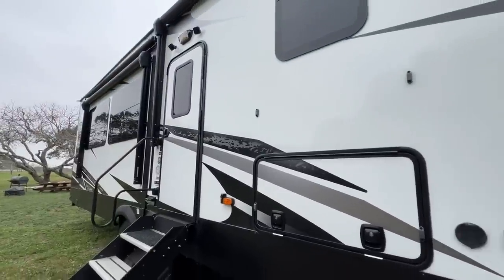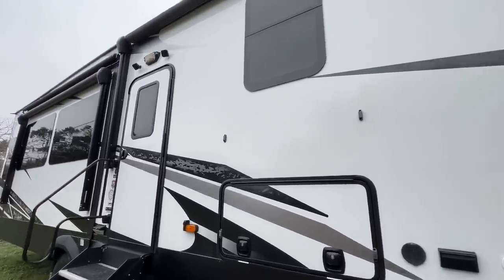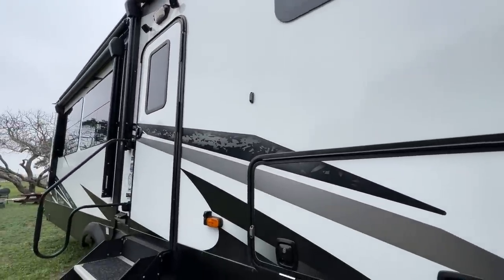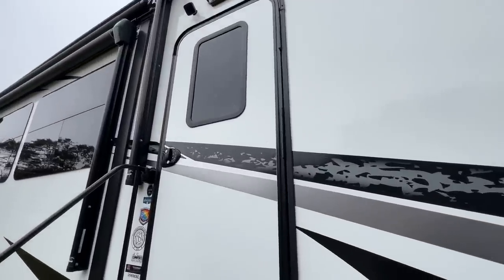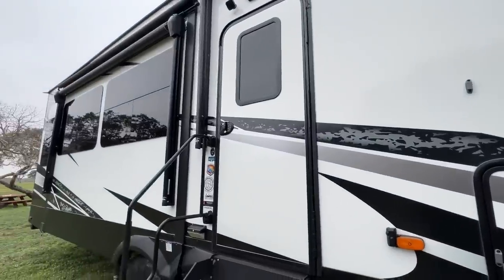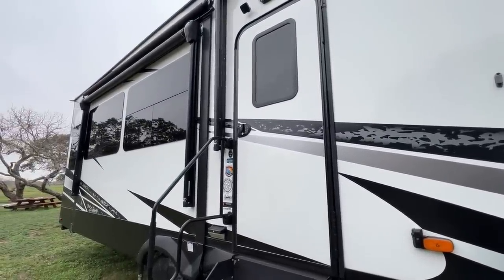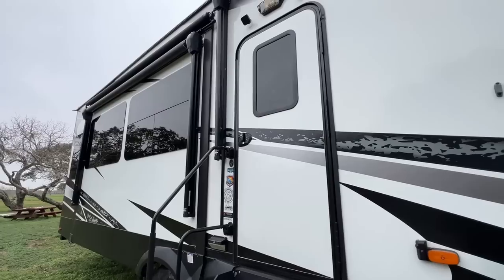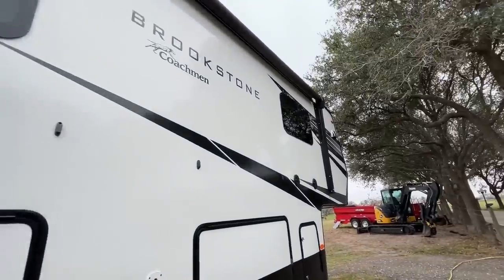The same reason you want to do that is the same reason why you wouldn't want to use a pressure sprayer to wash your RV — and the main reason is the windows. We have frameless windows on this RV, but on RVs that don't have frameless windows, like a standard frame window, you're going to have little slits at the bottom called weep holes. Those weep holes are designed to drain condensation and moisture from inside the glass to the outside. But that means the opposite can hold true — if you spray your windows from the bottom, you can actually force water into your RV.